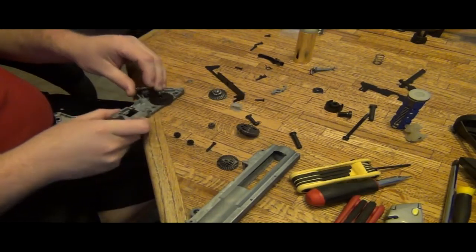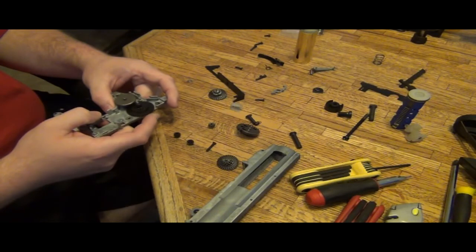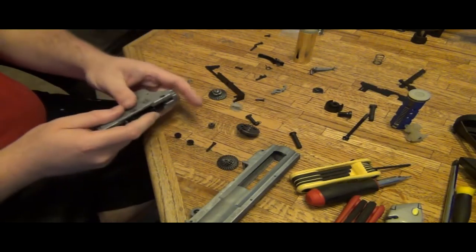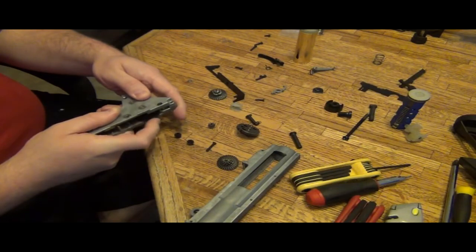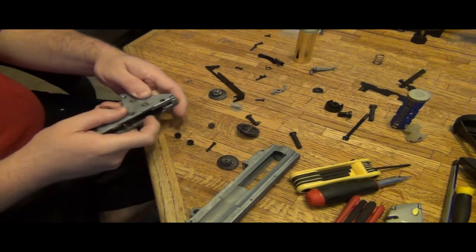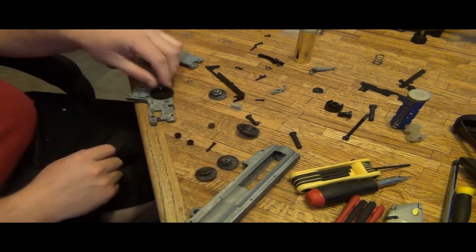So what problem am I having here? It's got to be in the bevel because it's a short spin cycle. If it was a long spin cycle, it'd be in the spur, if that makes sense to you, because see how many teeth the spur has. But it's somewhere within the bevel, probably. Close this up and, no, it's probably in the spur. See, because look, it's a long spin cycle. See that they don't mesh together properly. However, I do have more gears to try.